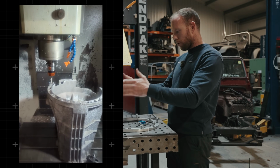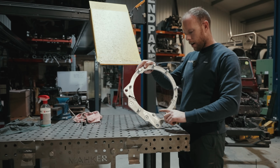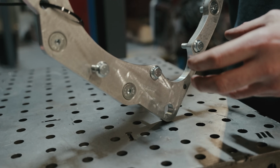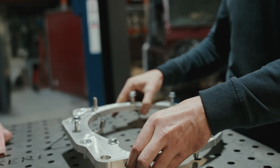You'll see in this next video, he dropped it into the mill, picked out the crank sensor and worked his way back from there. Then we had a bit of a headache here with the starter area. This is where the starter motor lives. Because you don't use the existing Puma one, you actually use the BMW one and the BMW flywheel, the starter motor has to be moved. So then we sell a dust cover that goes on the back, basically.